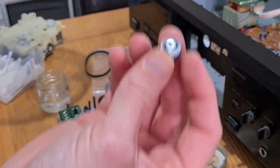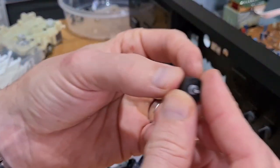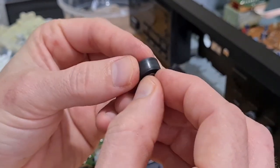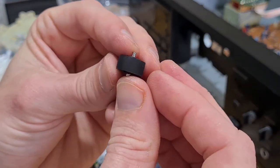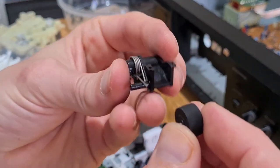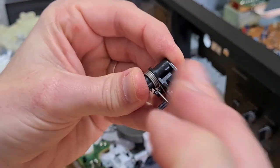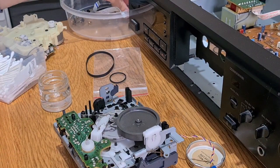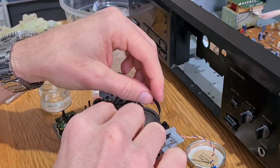Here's our nice new pinch roller - the perfect size from Slavo in Slovakia. The difference between the old and new is clearly visible on camera. You need to take the axle out of the old one - it just slides out - because you don't get a new axle with pinch rollers. Then that goes inside the new roller. Just make sure it's square before you push it home into the holder. Give that a light dry cotton bud wipe to make sure there's no grease on it.